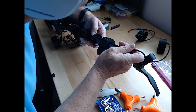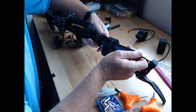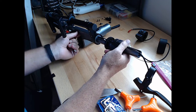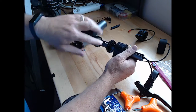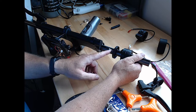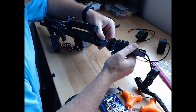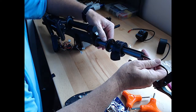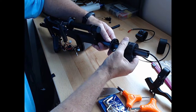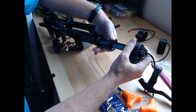And I can see that my little brake line cable gets caught in this spacer, so we're just pulling them both out at the same time. So when we put it back together, this spacer, which goes on first, I have to make sure we feed both cables through. There's no way you feed that through after it's already disconnected. Well, maybe you could, I don't know, but it doesn't seem like that would be the easiest. All right, so that's plenty of cable there. Throttle is coming off.